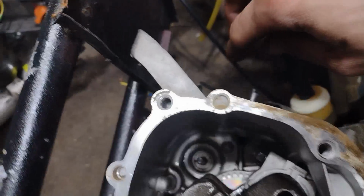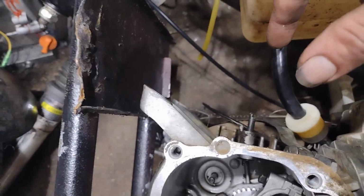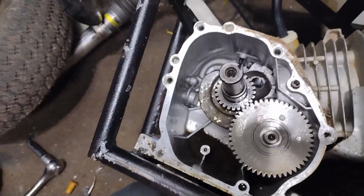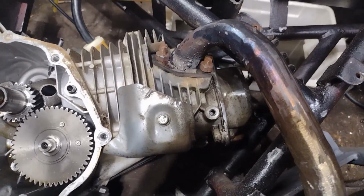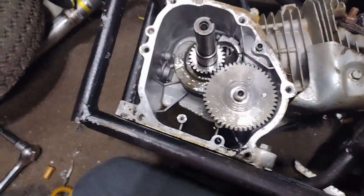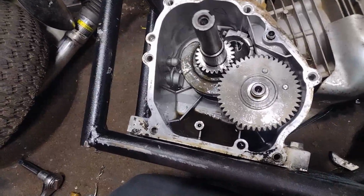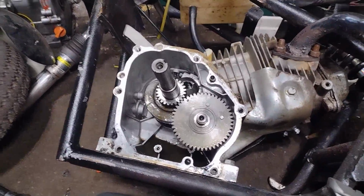Now to put the washer and the little clip back up here. Put my throttle arm back on, get that adjusted where it needs to be. Put the side cover on. Pull the shock off, pull the valve cover off. Make sure the valves are still on properly. And then should be able to go for another ride and do a little more than 25.